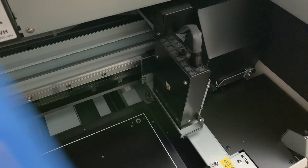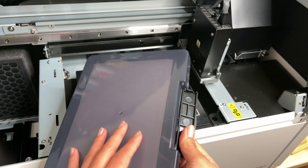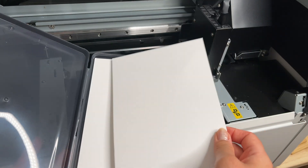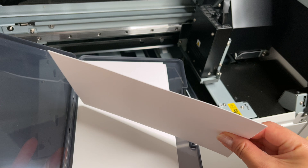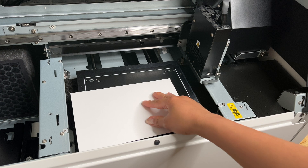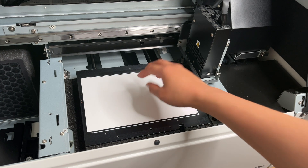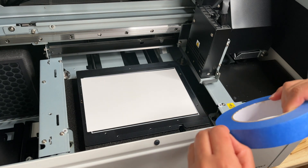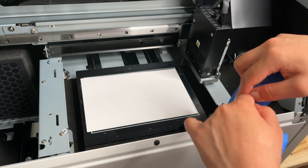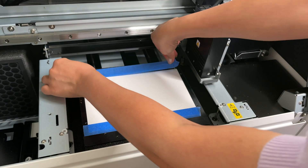Let's get a fresh start so you can see this more clearly. I'm using a general cardstock sheet of paper — an 8.5 by 11 that I cut in half. I like the thickness because it's rigid and lays flat really well. I'm going to tape around all the edges with some blue tape, which makes it easy to change out without leaving sticky residue. It's a little bit too short, but the tape will cover that area so we won't get ink on the table. Make sure it's totally flat with nothing sticking up, because you don't want that to damage the print head.